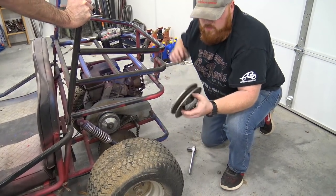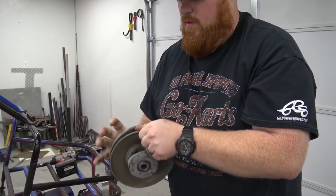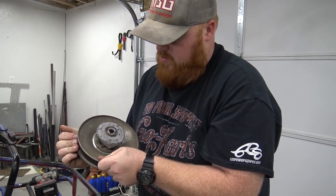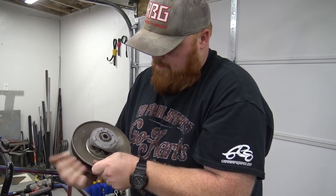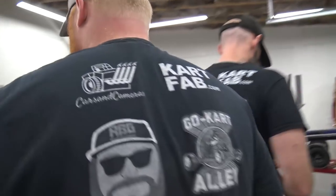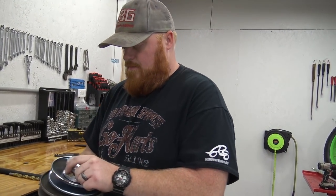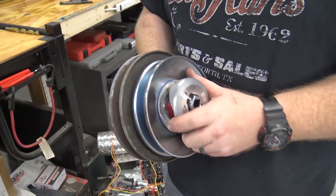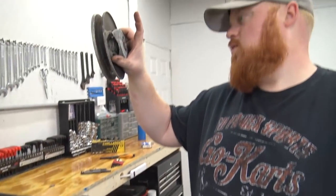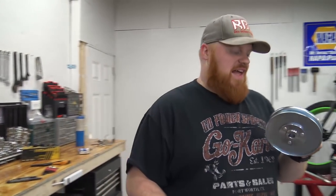That old 7-inch pulley, let's see how worn it was. It's a green spring in there. It's a true Comet. Yeah, not horrible. Let's see how good the new one is. Oh yeah, like twice. As you can see, size difference. That's why it's just a pain getting these belts, and they're kind of unique belt sizes, so I'm just going to go with this old classic.